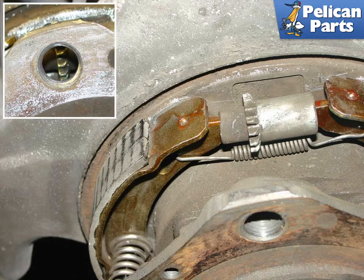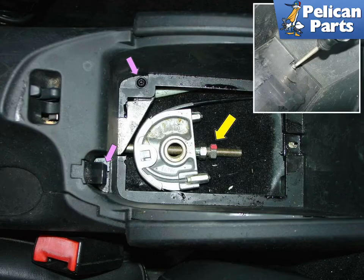Removal of the brake disc is not necessary for the adjustment. Shown here are the ends of the two parking brake cables wrapped around the turnbuckle. The two nuts that lock together need to be loosened prior to your adjustment process and then tightened up later on.